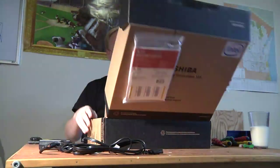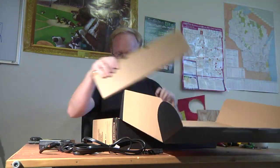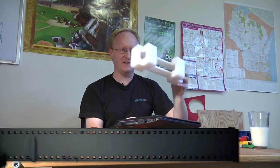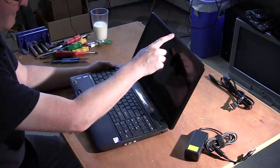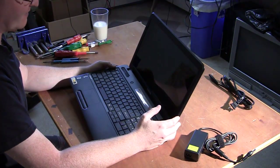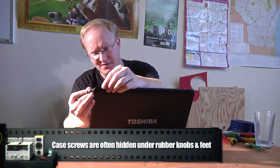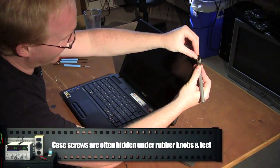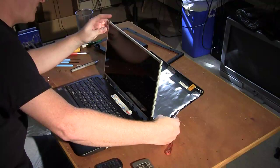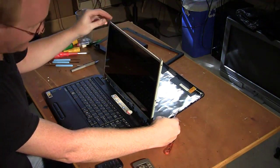Got a Toshiba laptop here. These are eerily familiar to the coffin padding they used to have on the Xbox 360. There's no webcam or anything else up here on the screen, so there should be minimal amounts of components for us to rewire. One of the reasons I picked this model, besides it being cheap, was the very obvious screw holes. The frame comes off pretty easy — it just kind of hooks around. Now we can see the friction hinges here, and the back lid is not held on by anything. It appears to be a metal subframe actually holding the LCD in place.